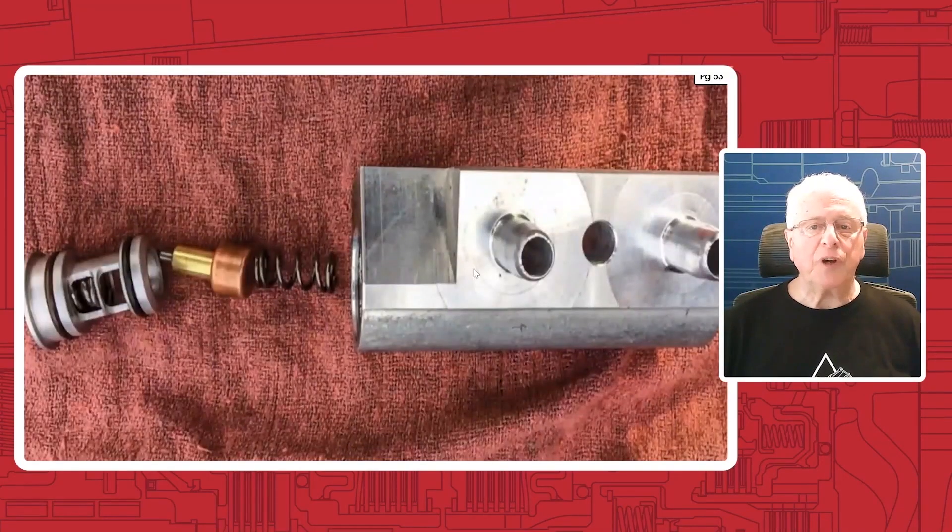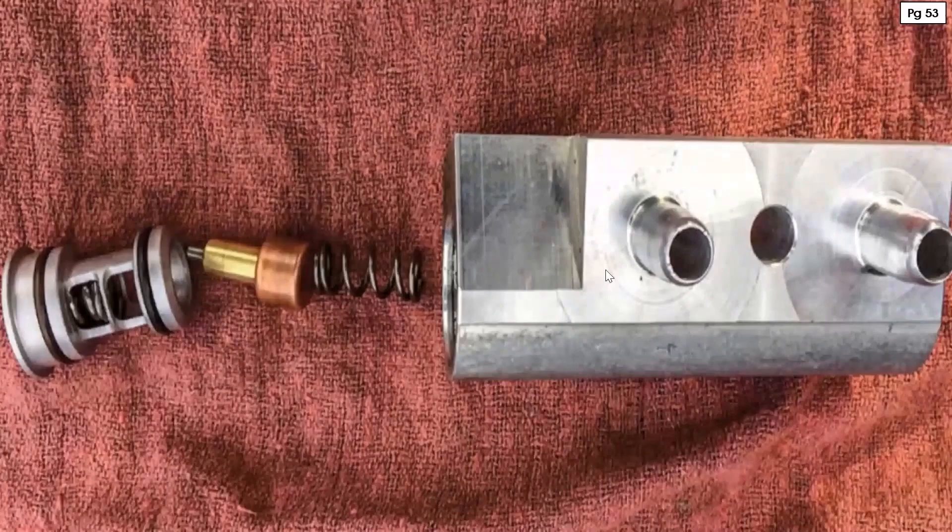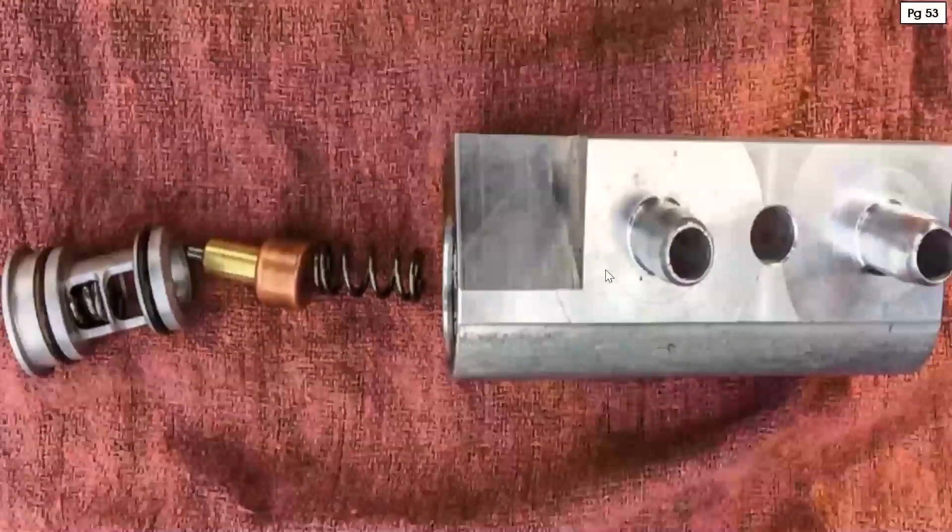You're all familiar with this situation. These units have a thermal bypass valve located in a cooler line manifold that bolts to the side of the transmission case. Inside that thermal valve it can be trouble — especially the earlier ones, which were made of plastic. They were terrible; they would swell and crack. We showed this in a previous seminar, where we showed you one that cracked. At that point, it creates a situation where the transmission is running hotter than it should.